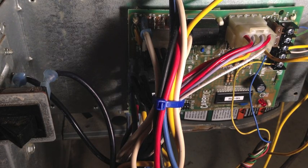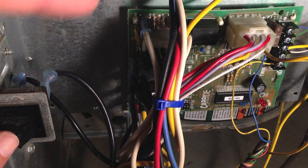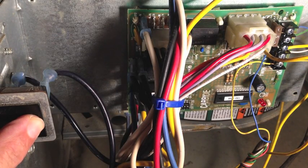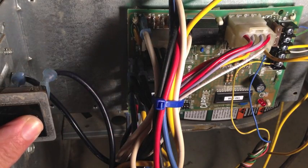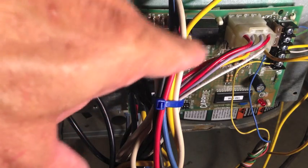The way I tested the motor without taking it out was using this switch right here. This is a kill switch that, when the access panel door is installed, this switch is pushed in — and watch that little red LED light down there. When this button is pressed with the panel door on, it gives power to this control board. So it has power right now — it's a safety feature. When you take that panel door off, the switch pops out and it kills power to this board.